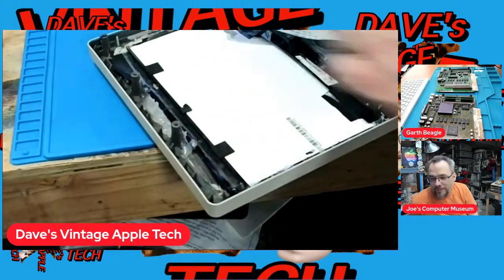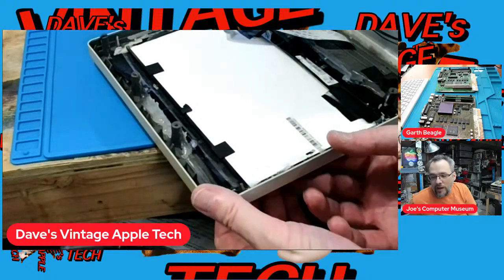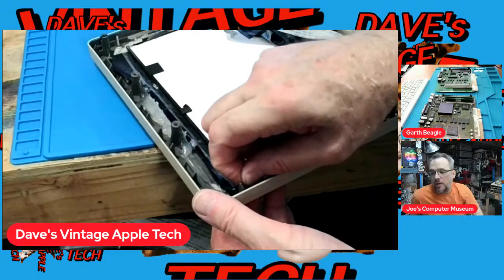Just regular hot glue, high strength, low temp hot glue. Did you know that isopropyl alcohol will get under the surface of the glue and separate it from anything it's stuck to without actually dissolving anything? You can just peel it right off.